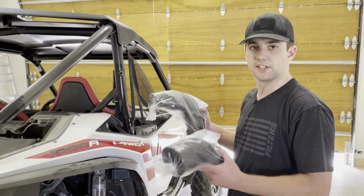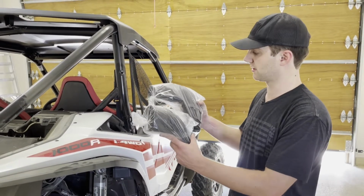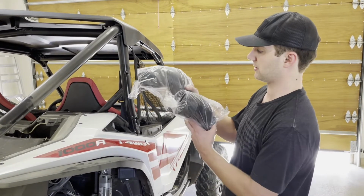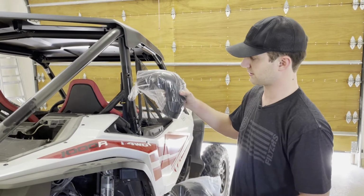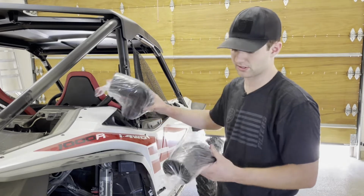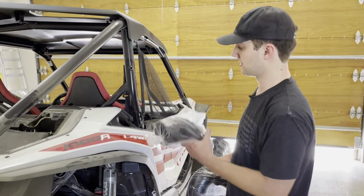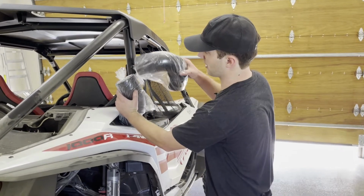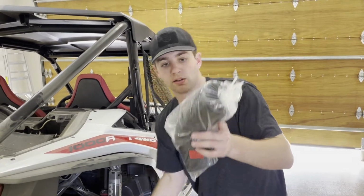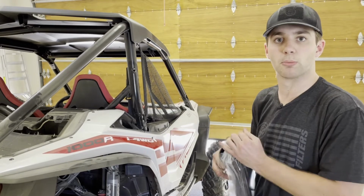We're going to go ahead and get the upper tube installed. I spoke about it a little bit earlier, but we offer 2 upper tubes, and this is going to depend on where you're going to be mounting your S&B particle separator. The one with the more sharp angle is for the lower bar, so this is going to point your ducting right into your separator housing itself, and then with the close to 45-degree angle, which is what we're going to be using today, this is going to position the ducting ready to run up and make the turn for your upper bar. So I'm going to only be using the upper bar tube today, and I'll go ahead and dispose of the lower bar tube.